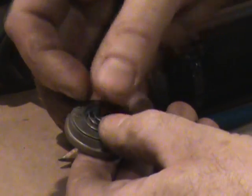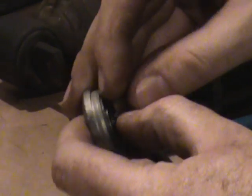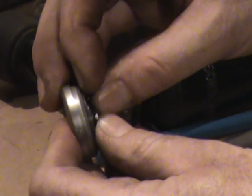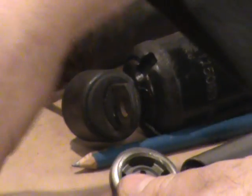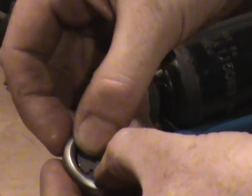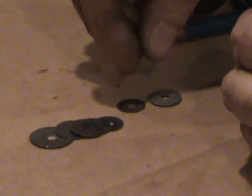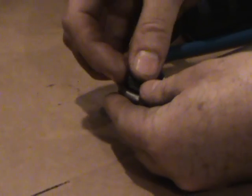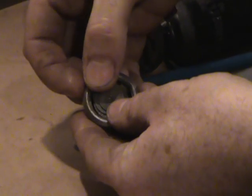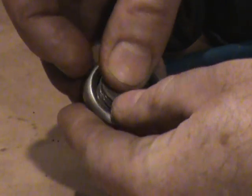I'll assemble it for you so you can see what it actually looks like. There's that little washer — it can actually pull back, it's spring loaded. And for the other side there's this special washer with two cutouts in it that allows the oil to flow through in a regulated way. The engineers have designed this so oil flows only at a certain rate in one direction and at a greater rate in the other. All these are just like a stack of cards — different size spring washers that stack up on that pin, which I had to grind down to disassemble this thing.